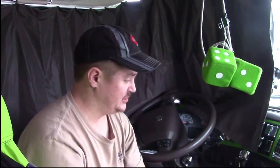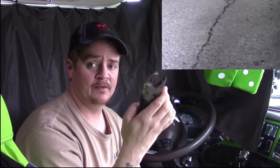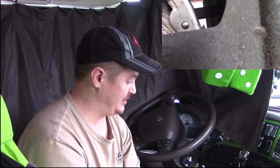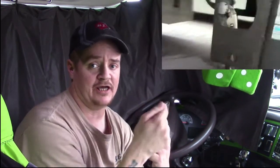What you do is get your pair of vice grips. Set your brakes, pull your pin, pull your button out, set your pins, then take your vice grips, go up behind the button, and clamp it down tight. Now come back in and release your trailer brakes. When you release the trailer brakes, that button is going to be stuck — it can't go in — so the pins stay out.